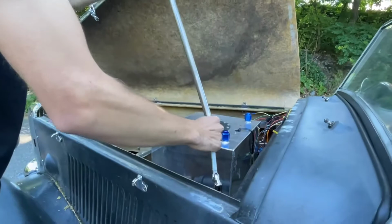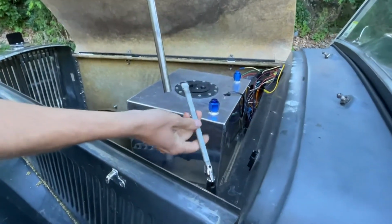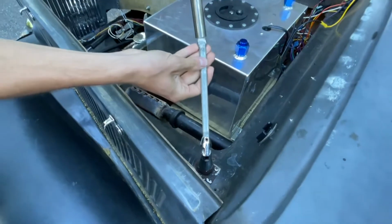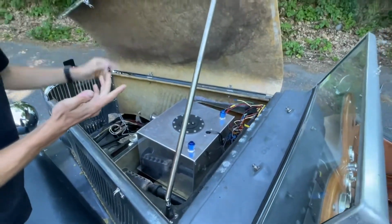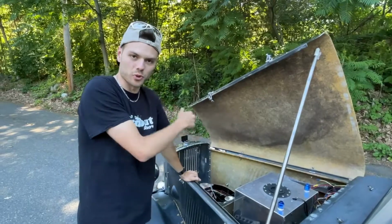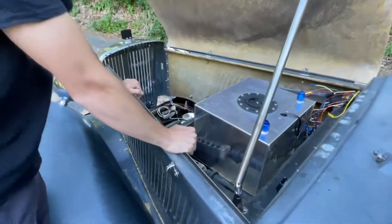This was made by Tarpy, and you can see that it's essentially an old socket on the end. It's made for something like a lug nut. However, the shaft is perfect and has an amazing U-joint, so you can stick it right inside this metal pole and use it as a hood stand. Once again, perfect for the MG. And yes, we tried to weld it, but burned through on the welds, and it's held in by 2 screws that probably shouldn't be holding the amount of weight that they are.